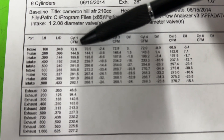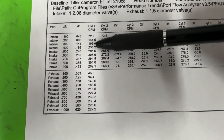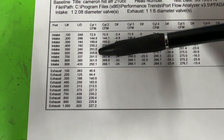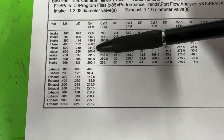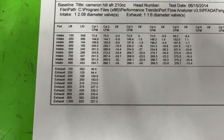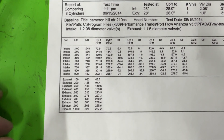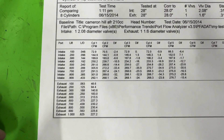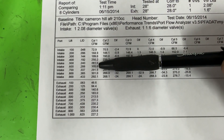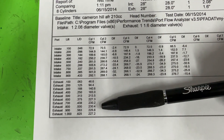Looking at the flow sheet — cylinder one is stock, so this is like I'd flow it normally. The part number on this head is 1050, so it's an AFR 210. It went almost 306 CFM. Usually AFR 210s will barely hit 300 to 301, so this is a considerably better set — really nice flowing heads. The exhaust was really good at 227.